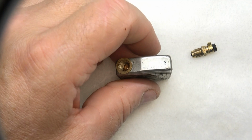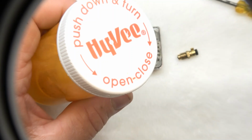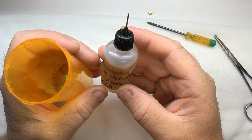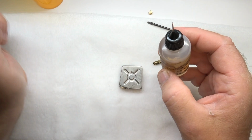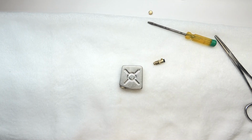Okay, so when you get something like that, what I usually do is I get my bottle of phosphoric acid, 85% concentration, okay? And what I'll do is, when I got to that point, I stuck this down in there around that and just let that set. What do you think? Well, what do you do that for? Well, that eats up that gummy stuff and allows you to break free. Then you let it set a little bit and try to dig around it